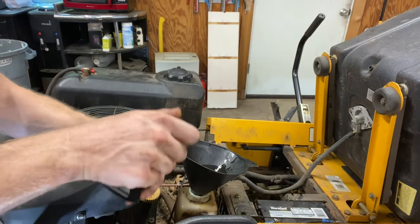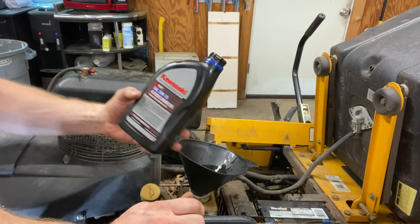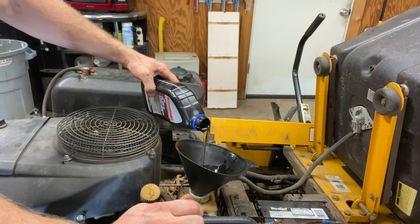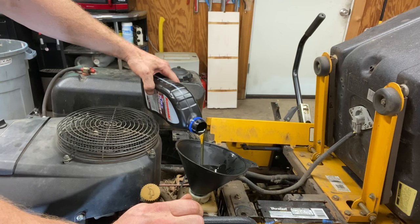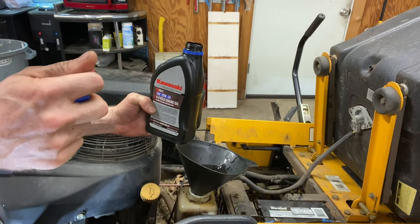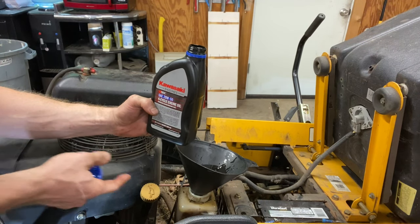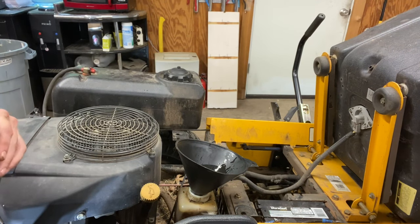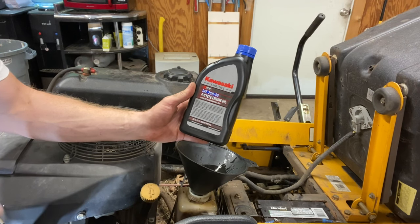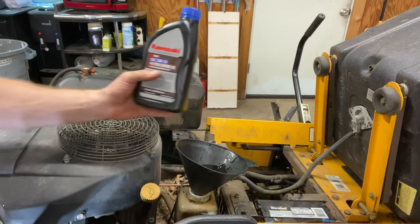So what I'm going to use - what's in it now is 30 weight, so I'm kind of curious if it'll run a little thicker. I just want to stress that filling these up, this is not your usual 10w30 car oil. It's very thick and it's going to take a while. As you fill it up, you want to watch underneath the transmission to where that oil starts to dribble out of that vent hole. As soon as it does, plug that vent hole and go to the other one - loosen up the other vent hole on the opposite transmission and do the same thing until it fills up. This one took four and a half quarts of this Kawasaki engine oil. There's a great deal on Amazon for five quarts for about 40 bucks. I'll have a link below to that.